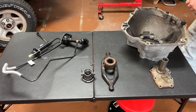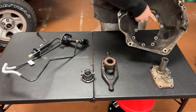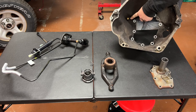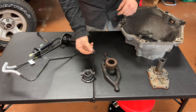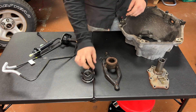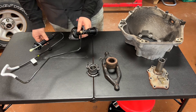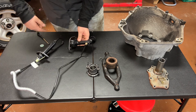Laid out here is everything you're going to need from a 94 and up AX-5, starting with the bell housing for the external slave. Make sure if you're getting it used like this one, it has the ball pivot stud. You need a bearing retaining plate, your clutch fork, and the retaining clip for the clutch fork that goes on that ball pivot. Pick up a new throwout bearing. And lastly, you'll need your master and slave cylinder, preferably in a kit like this with a new line.